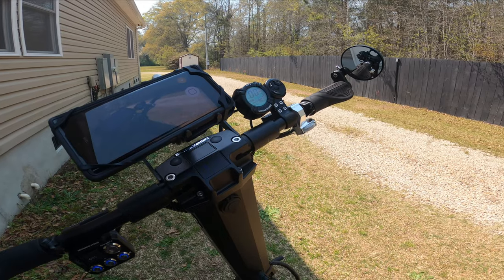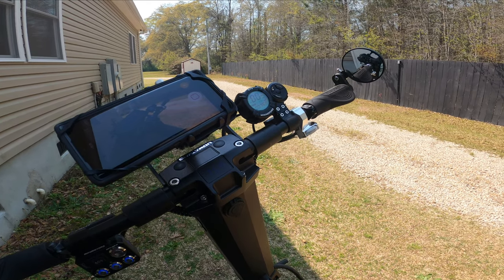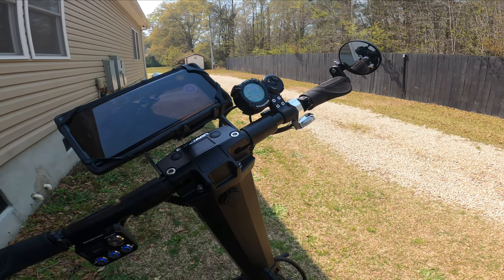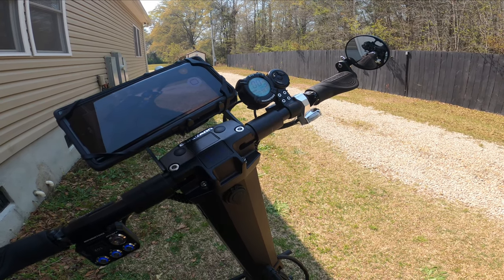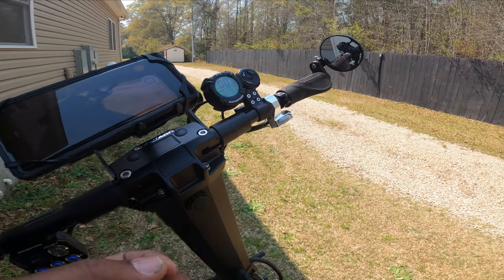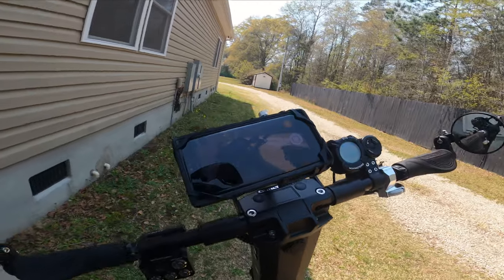And so I put enough heat to those little legs after I cut the hall sensor off that it melted the solder that was holding those ceramic capacitors to the circuit board. And they just slid off of their connection, and I didn't even pay any attention to it because I wasn't familiar with the leads that fed the wires that connected the throttle. And so that was my inexperience with soldering that caused me to miss that.